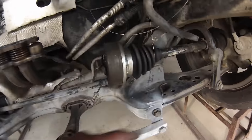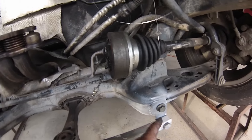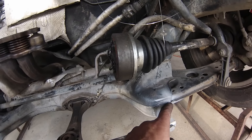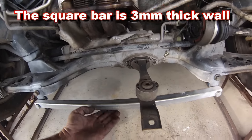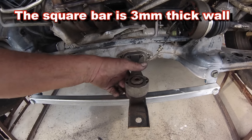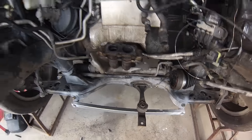That's just about ready to pull the motor on that one. And over on the 2-litre rally car, I've put the bar in, I've welded the tabs in place from 5mm steel. If you don't weld those they don't provide any support for the suspension because they can move sideways - that's why they're welded. And that bar stiffens the suspension and provides a mounting point for the sump plate. I've used the lower rear engine steady arm as a reference point because that's the lowest point I could find on the engine.